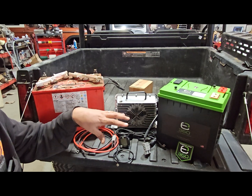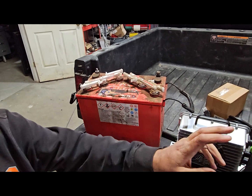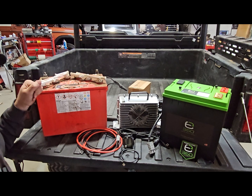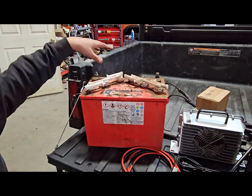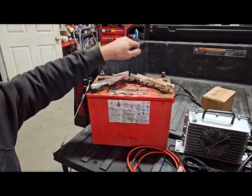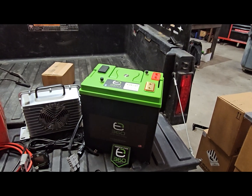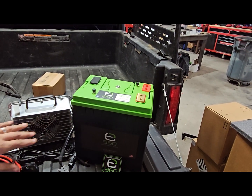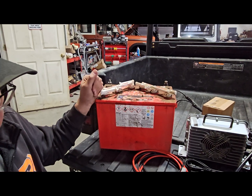Let's go over some of the specs on this project. We're taking out eight 12-volt lead-acid deep-cycle golf cart batteries and replacing them with six lithium batteries. The math may be a little confusing: the lead-acid batteries are rated at 155 amp hours each at 12 volts. With four batteries in series on either side, you basically have two big 48-volt batteries in parallel going to the speed controller — totaling 310 amp hours. The new lithium batteries are 48 volts at 36 amp hours per battery, all running in parallel, giving us a total of 216 amp hours with six batteries.